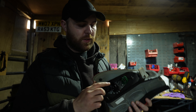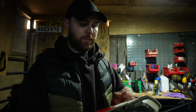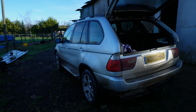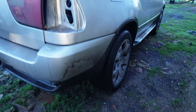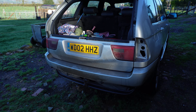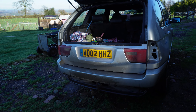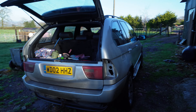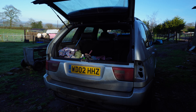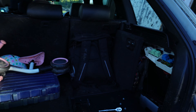All the bulbs are fine. I did find some corrosion in the middle of the pins - I'll show you exactly what I'm doing. We've also put brand new tires on the back, and I wanted to get the tracking done because the wheels were like pancakes. The tracking has been done - the rear had 2.8 degrees minus camber and the toe was all out. The front was way off as well, so I'm glad I had it done. Four wheel alignment has gone up to about £68 but it needed doing.